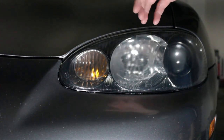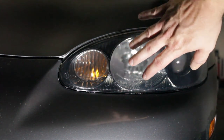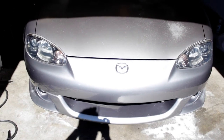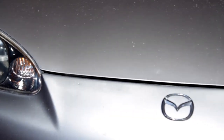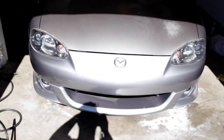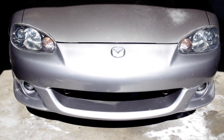Let that wax haze up and give it one final wipe down, and we are done. There we have our final product — a nice and shiny headlight to match the one we've already done. This looks fantastic. Huge upgrade to the aesthetics of the car. Now these headlights look like they should. Just look at that difference. When we get that nice fresh coat of paint on here, this thing is going to look amazing.